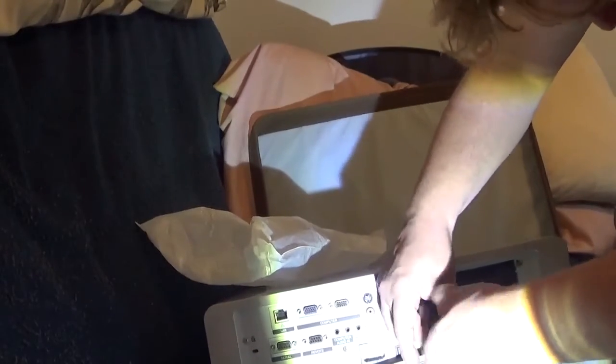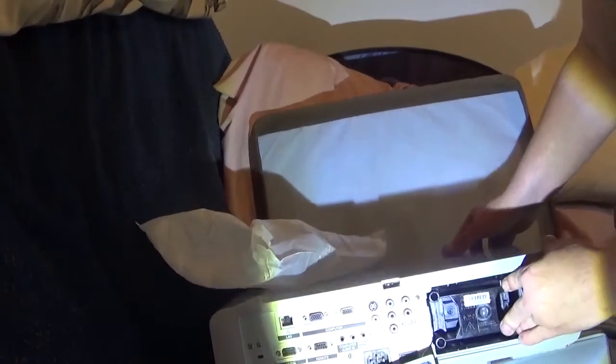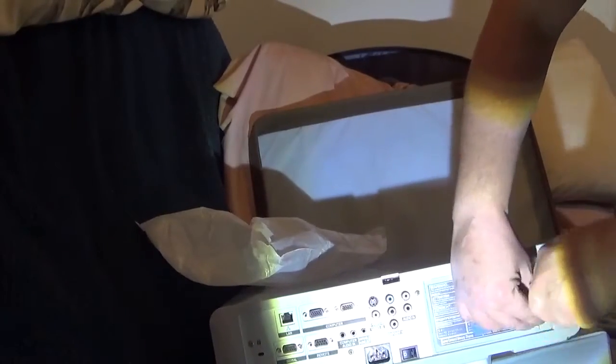After I do all this, I'll have to set it on the table, get it powered up, and then go into the menu and reset the hours through the menu. So suddenly it's in there — now just put this plate back on and tighten these down. It does have a safety switch so you can't run it without the door on it — you have to have the door on it. And that, as far as replacing the bulb, is done.